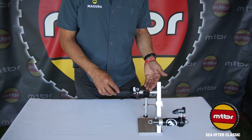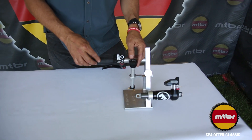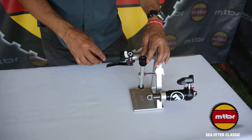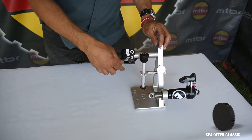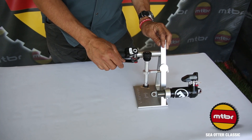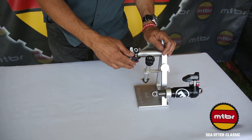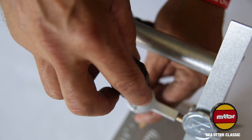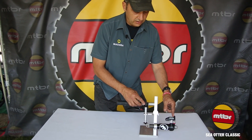With our ELECT compression cartridge for the suspension fork, it's an automatic compression lockout that, once calibrated with this top button, you can set the zero, or what is flat. Once the fork detects a change in the terrain surface, it will automatically react and open or close the valving to give a lockout when you're climbing, and when you're descending it unlocks. It takes just 6.5 degrees of variation to react, and it reacts in 0.02 of a second. It reads the brain of the cartridge for the suspension fork and also reacts the shock at the same time.